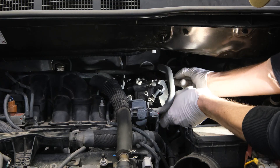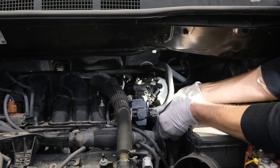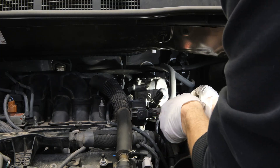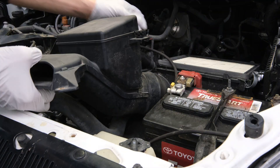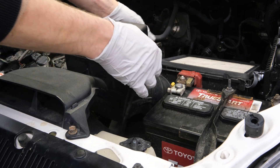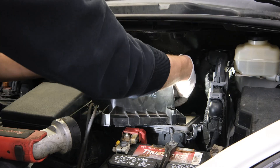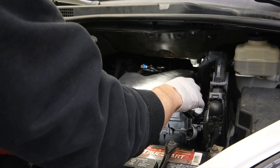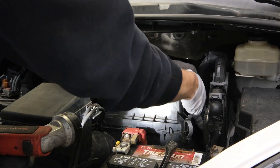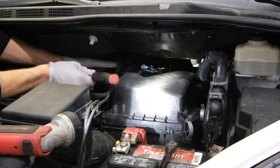With the plenum torqued down, we can reinstall that throttle body with those 10-millimeter fasteners, snugging those up by hand. Then we can move along to installing the airbox once again — install the snorkel tube, put the fasteners into place, vacuum hoses back into the retainers, and the airbox can be reinstalled back into its position. Connect that mass airflow sensor so we don't forget that, push it back down, get the clips onto the air filter box, hook up the vacuum hoses one by one, and then tighten down the snorkel clamp.